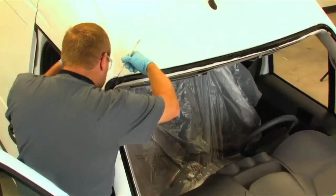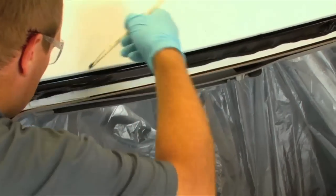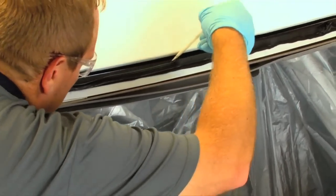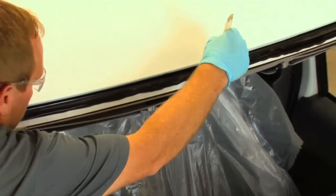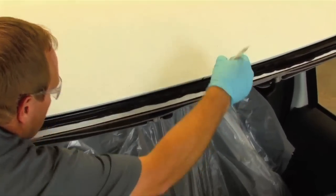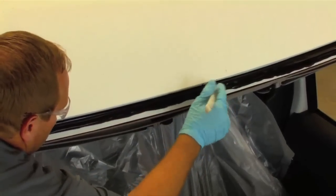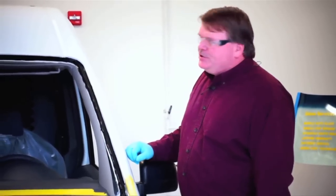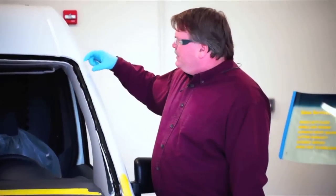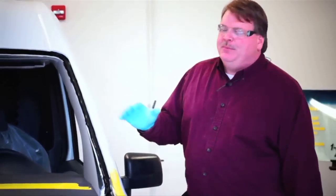You'll notice Buzz has followed along the original urethane, stayed within the boundaries, and didn't put in an excessive amount. This is important — if you put in way too much urethane, you can actually block the drainage path of water coming off the vehicle and cause corrosion. Too much can almost be as bad as too little. Your tips are usually set so the urethane is the same height as the metal on the sides, since the windshield is about a quarter inch thick and will set down to give the proper height and bead.